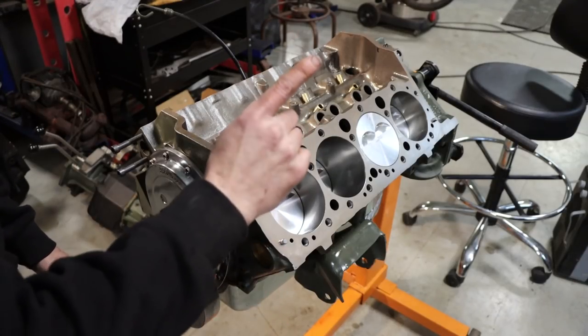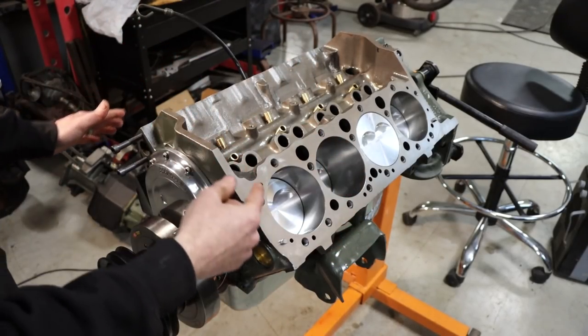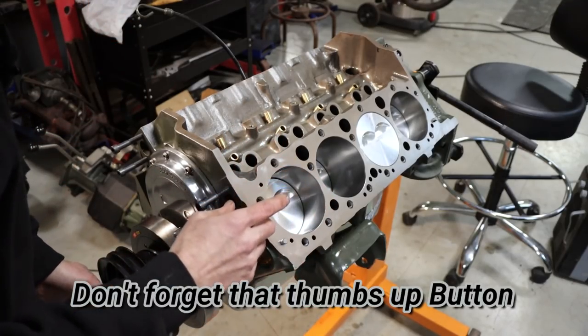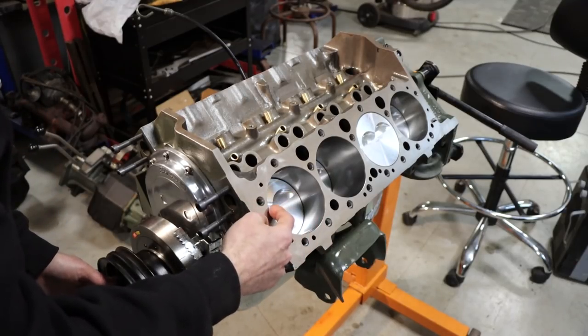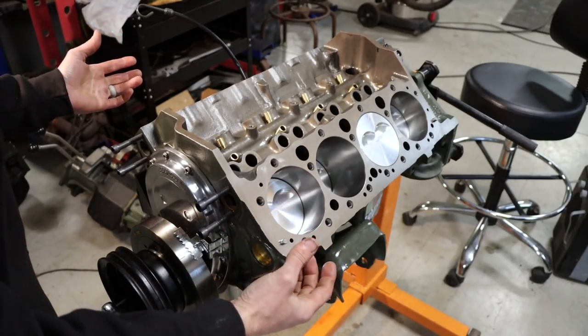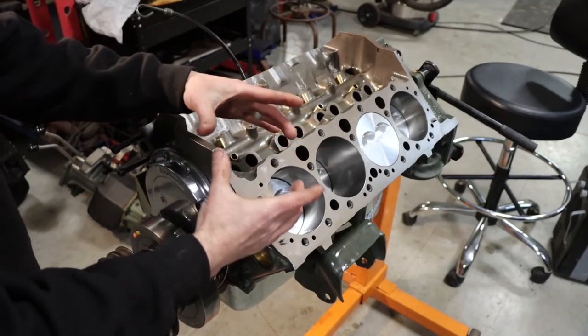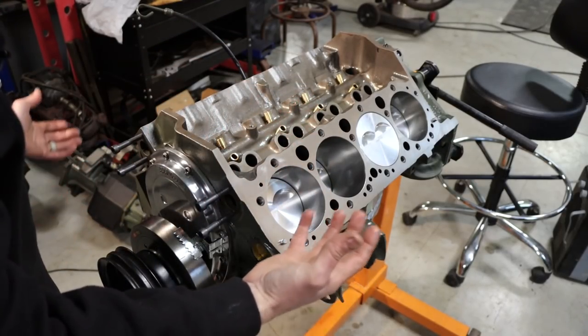Shh, be quiet for a second. I want you to hear this. Now, as I turn this engine over by hand, I want you to listen to the sound that it makes. It's kind of a rough sound, actually, and that's on purpose. The crosshatch, the surface finish on these cylinder walls, is pretty rough at the moment, and it's done that way on purpose in order to make the piston rings actually seat to the cylinder walls or mate well.